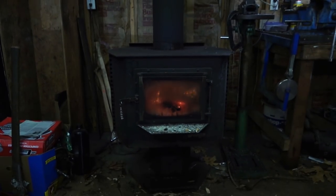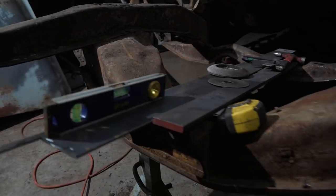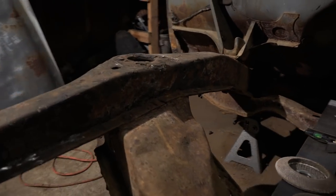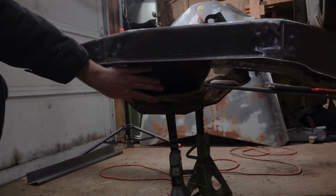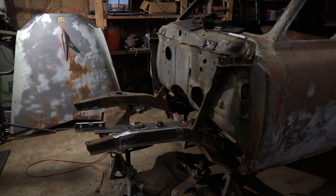So today I think I'm just going to work on this front end. The car was a coil spring front end, so it's got big coil buckets in the frame. I'm just going to work on getting rid of those, clean up the frame, give it more of that straight frame rail look — having coil buckets sitting there on the frame looks stupid. I've got one side that's almost done. My mounting holes for the fenders and everything will hopefully be in the same spot.